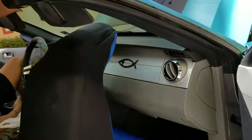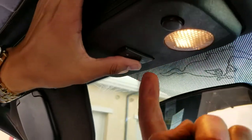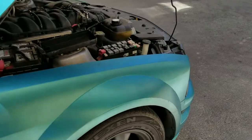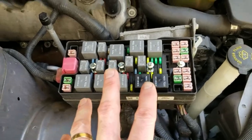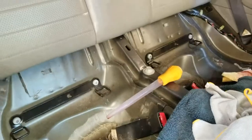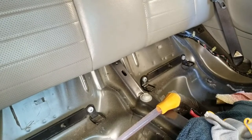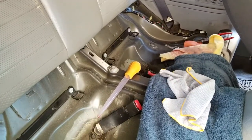Our problem with the button going up — we actually have to push it in quite a bit and push it really hard in order to hear that click. The down one is fine. So just know that in case your car is doing the same thing. That is how to determine if you need to replace those relays or not. That is problem number two we're trying to solve to get this top back down — and that is not our problem, but it might be yours. Hydraulic fluid has been inserted and that did not work, so unfortunately what we need is a new convertible motor with hydraulic attachment, which is covered in my other video. I'll link that in the description box below. Thank you so much for watching — stay tuned for video number three and we're going to get this convertible top down. It's all about eliminating the problems and finding solutions.